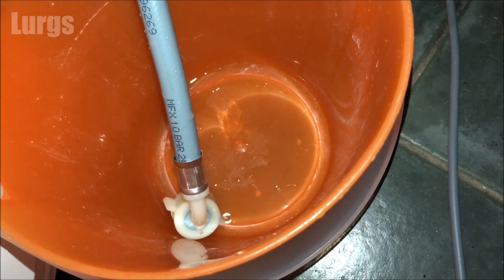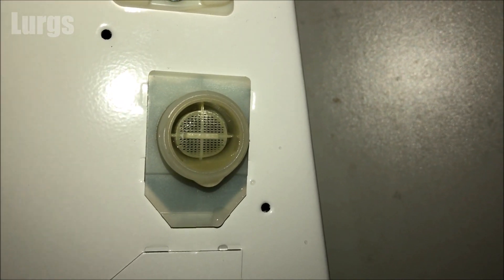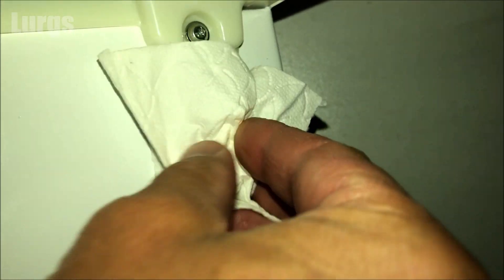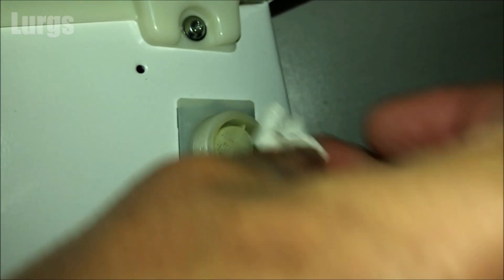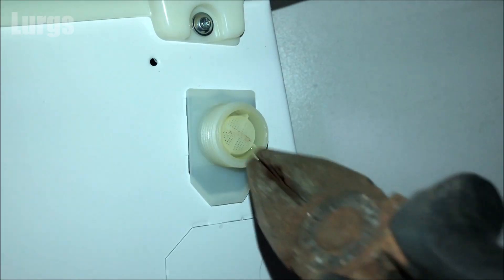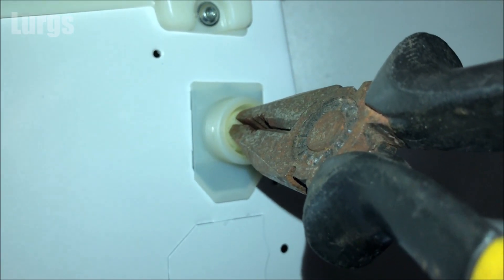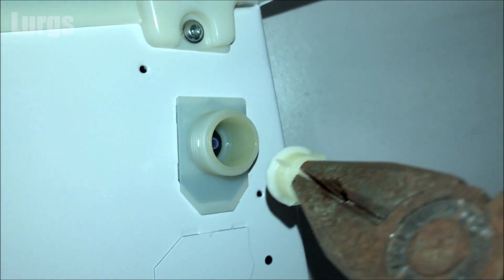The tiny inlet filter — the AquaFilter — is inside there. Take a tissue or a rag and try to dry it off as much as you can, because when it's wet it's really difficult to get a good grip with your pliers. Make it as dry as possible, then take your pliers and get a really good grip on the flat end which is just slightly poking out. You're pulling it out towards you, just wiggling it — and there we go.